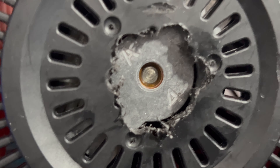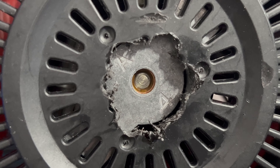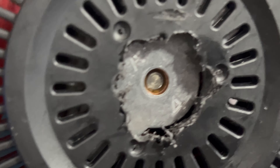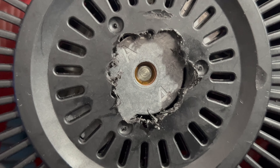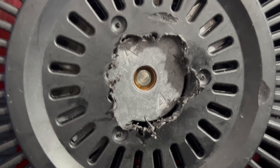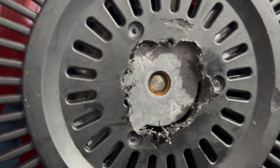Here we are back with this fan again, the Zi cooler. I did some work on it off camera and discovered that it has a two-pole shaded pole motor with an open bearing in the back. I drilled out the back a little bit so I can have easier access to the open bearing — and there you go, not the most professional but now I have easier access. I gave it quite a bit of oil, that's what it was in need of.